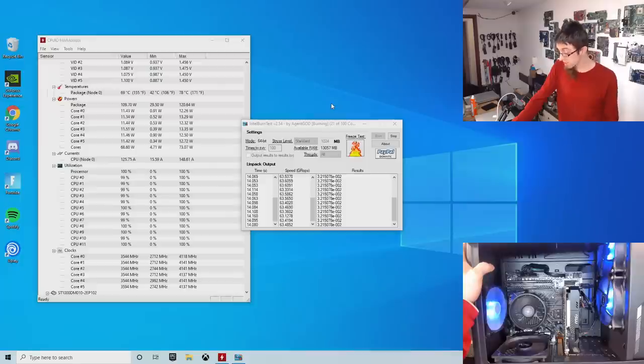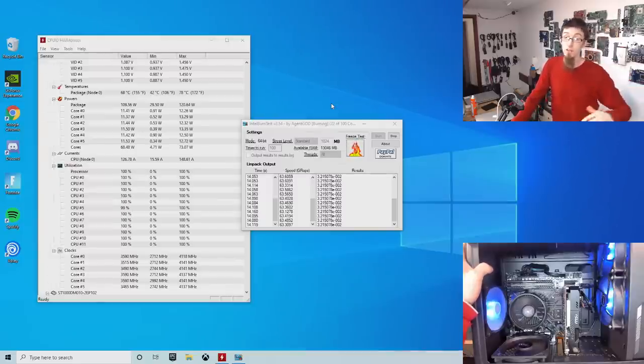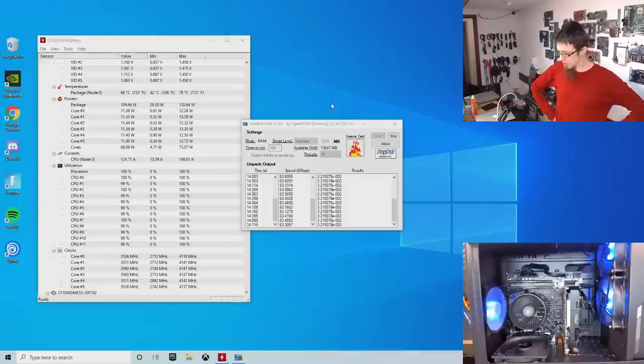And if we're really stuck, you could even just ask the customer what games they play. However, in this case, no prizes for seeing that Fortnite icon on the desktop. I don't want to sit here and play Fortnite to figure out what's wrong with that. I don't play Fortnite. I don't know how to play it. So that's not an option I wanted to go down. However, thankfully, we had reproduction just on the first test I ran. So that's great. And it'll be good if we get a fail in MemTest as well.